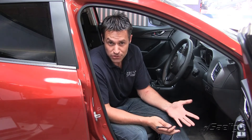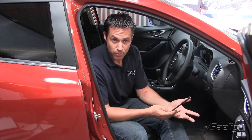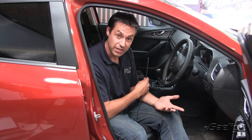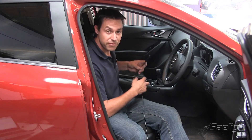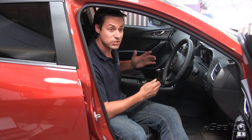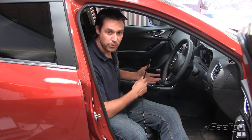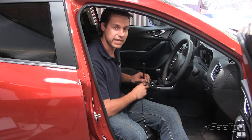With the keyless entry detector, not only will it detect the keyless entry side of things, but we can also look at the smart start or keyless start as well. We're talking about transmitters outside of the vehicle in the detection zones, but also inside the car there is the same thing. So if we've got an issue with the vehicle not actually changing state when pressing the ignition on and off button, we can actually determine whether or not the car is actually looking for the key in the first place.